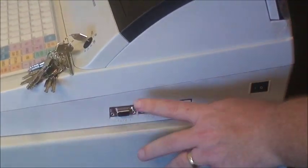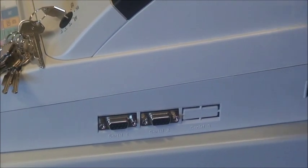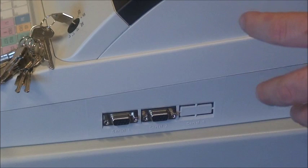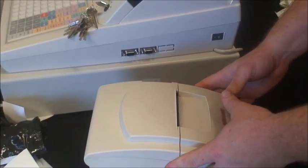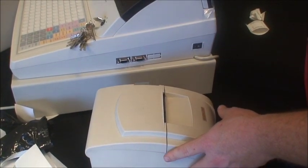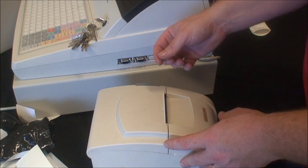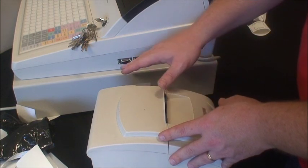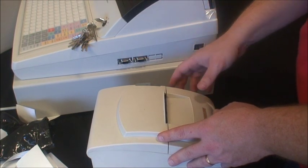Also on the 5200M we have two serial ports on the side, as previously mentioned. They are great for expandability and connectivity. You can turn the simple cash register into a cafe restaurant POS machine by attaching a remote printer such as this one. This can live in the kitchen — the dockets that you ring up, as well as giving a customer receipt, will produce an order docket for the chef to start completing the order. You can have two printers attached — in fact one can be going to the kitchen out the back and one can be going to the barista making your coffees out the front, making for an invaluable and very well priced complete point of sale solution. You can also attach barcode scanners and PC connectivity to help you program the till and get meaningful sales reports.